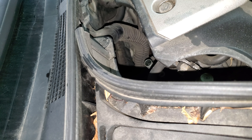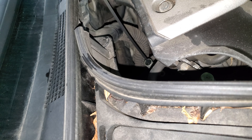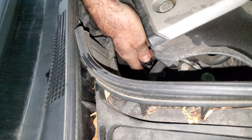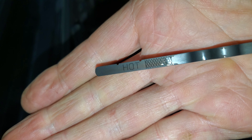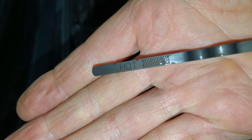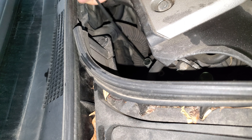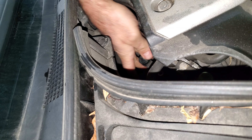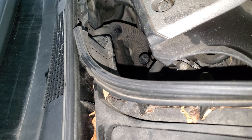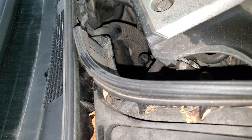Okay, this thing's hot — the cooling fans are running. It's on level ground and I let it run for probably about 20 minutes. The level's right at the top of the cross hatches, and I'm about four ounces shy of five quarts on this thing — it's all good. So I'm just going to put that bolt back in, torque it down to 6 foot-pounds just like a pan, and call it a job. Okay, bye.